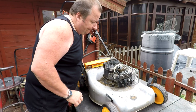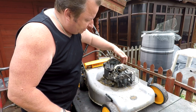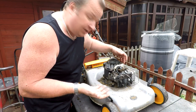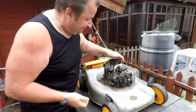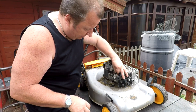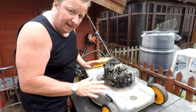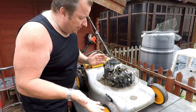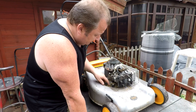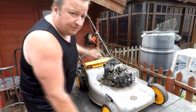In this case we're okay - the governor arm is moving freely, so we know that isn't the problem. But it's worth checking and ruling out. We can also clean behind there now, because on top of that carb inlet tube there is some rubbish. I'm just going to give this a blowout with the airline. There's loads of crap in there - I'm not going to send it back like that, I'll give this a blowout first.